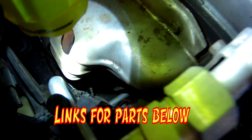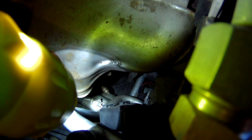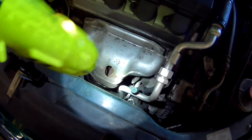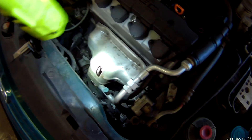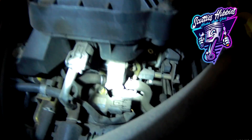Next is your bank one sensor one oxygen sensor. This is the oxygen sensor responsible for giving the computer information so it knows how much fuel to give or take away from the engine. And if you have a lean or rich condition, that's going to be the oxygen sensor you're going to look at. Look for exhaust leaks or anything like that on the manifold right there if you do have any lean conditions or codes.